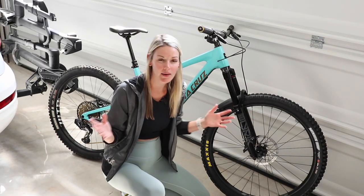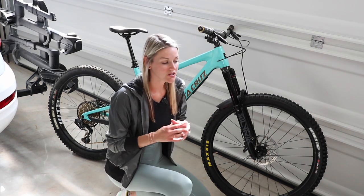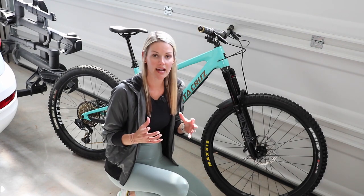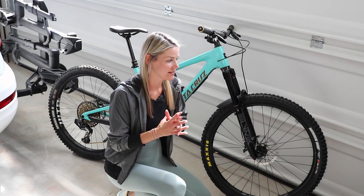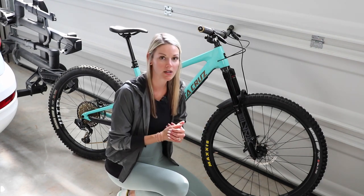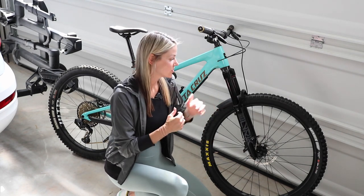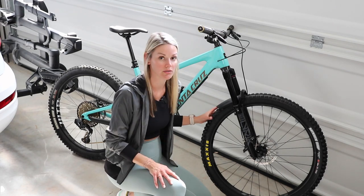Without further ado, let's look at the bike — this is her. The crazy thing is I read so many things about people messing with links to help the conversion, but the guys at the bike shop told me it truly is as simple as changing out the fork and buying a new wheel. One major detail: if your bike has a flip chip, this is what makes the conversion possible and keeps the geometry as close as possible — you just turn it into the high setting.